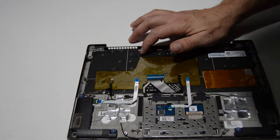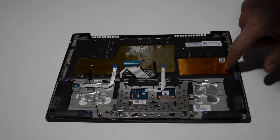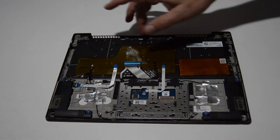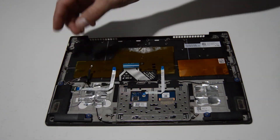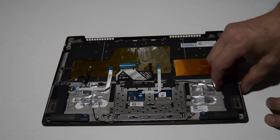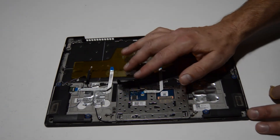We're left with the keyboard. Lenovo did leave this as a removable keyboard — there's just a number of small Phillips head screws, these look like one millimeter. After removing all those screws you should be able to remove the keyboard, no problem. Same with the touchpad — just a few screws around the perimeter and you can remove it. The speakers are just held on by rubber grommets, so those are no problem. That's basically it for the palm rest and keyboard assembly.